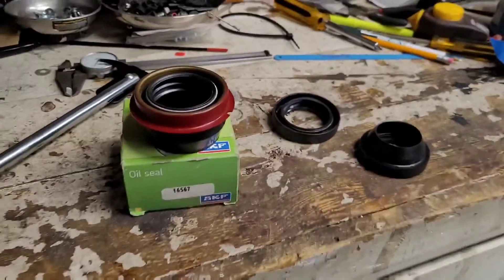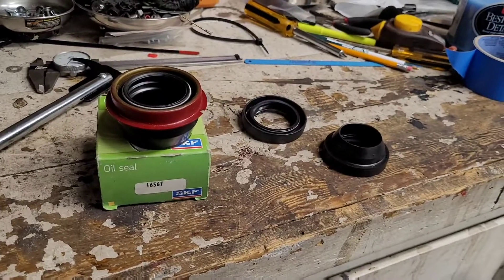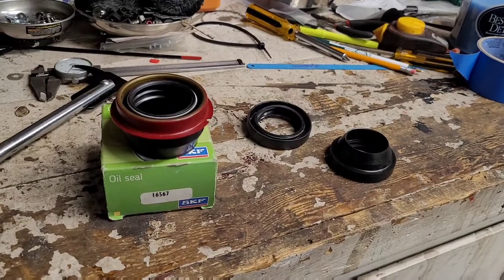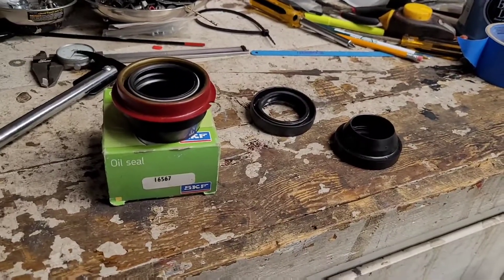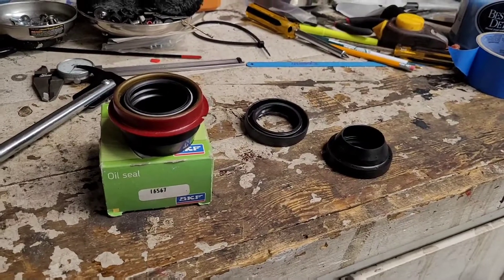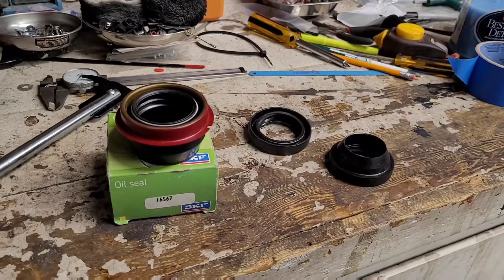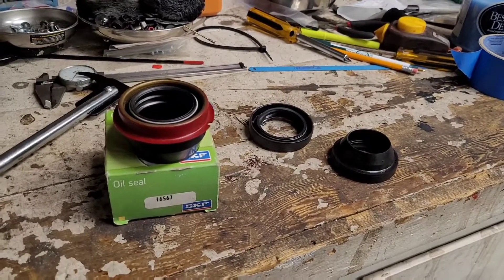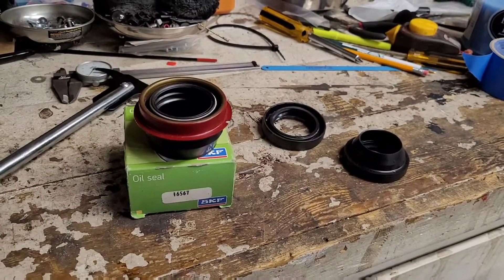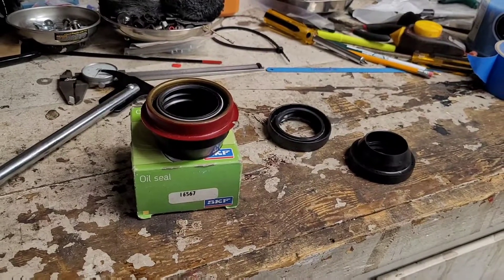What's ironic about this whole thing is that these are actually Ford C6 automatic transmission seals. Why would you have a Ford C6 transmission seal in a brand new Tremec? Well, it goes all the way back to the mid-1970s. The mid-70s tailshaft design that BorgWarner designed is what they used on the Tremec — consequently, that's why you have a Ford C6 automatic transmission bushing or seal back there.